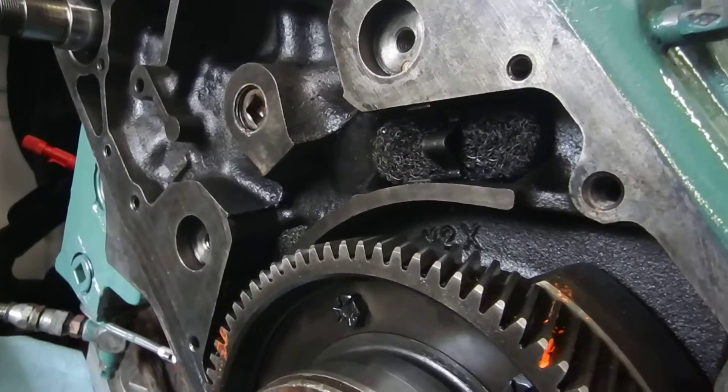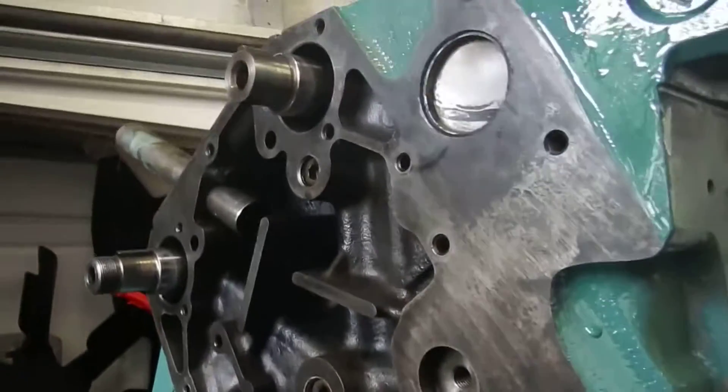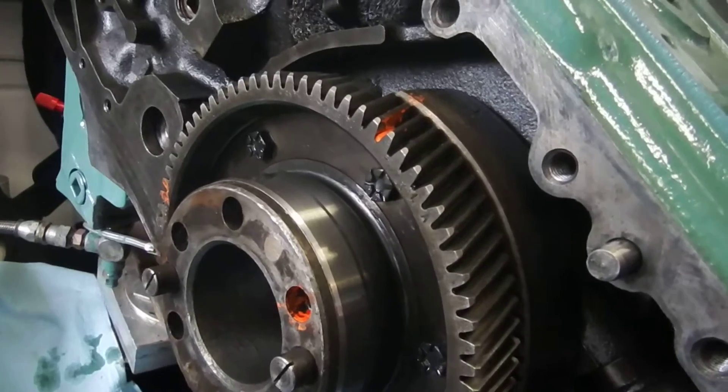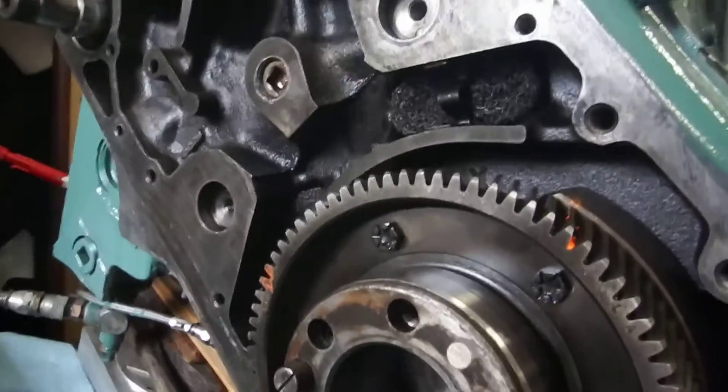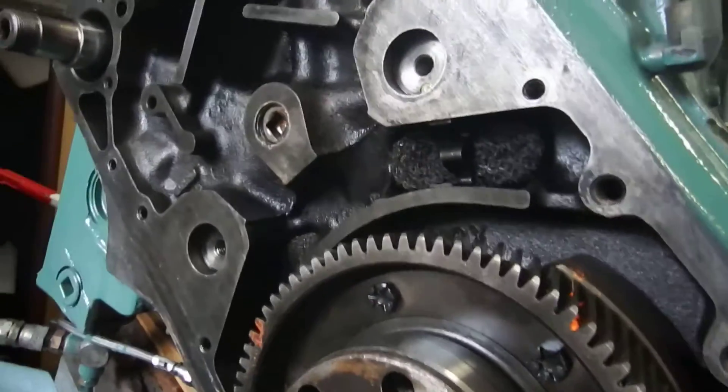It's kind of a neat idea, but it's a pain because both of the engines that I've had in the 71 series have leaked from this gasket on the end plate. And it's really hard to get to. You definitely would want to — you could do it in a bus, but it's a lot easier if you pull the cradle and you can attack it right there.